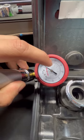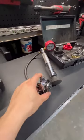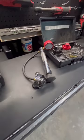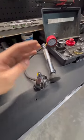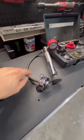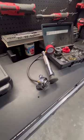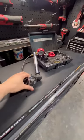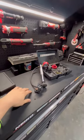If you've got a leak, that needle will immediately begin to drop off and you know you've got a leak — now it's time to start looking. These can actually help you easily find out where certain coolant leaks are. If you've got a band clamp loose or a small nick in the hose, as soon as you start applying pressure to that radiator, that water is going to start shooting out and you'll know right where the leak is. This thing has saved me so much time looking for coolant leaks — it really helps zero it down, especially if it's just something simple.